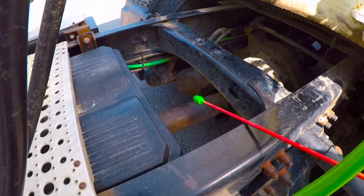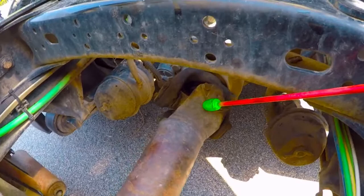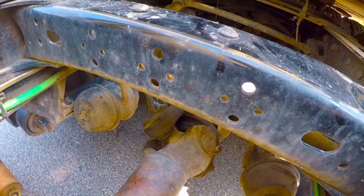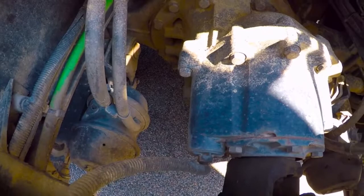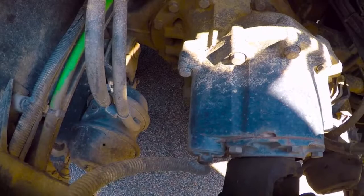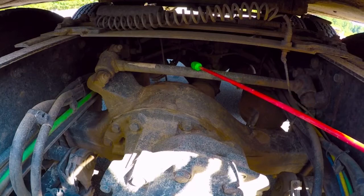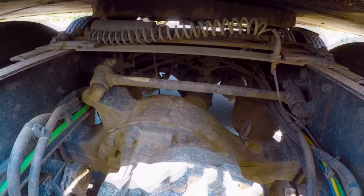I'm going to begin moving towards the drive axle. But before I do, I want to make sure my drive shaft is not damaged, not twisted, not bent or dented. Also my U-joint here does not have any excessive play — I go ahead and try to turn the drive shaft a little bit to make sure it's not loose, and it's not. My rear drive axle I'm checking to make sure it's not damaged, not cracked anywhere, and I don't see any leaking fluids. Looking back here, I can see this rod which is my torsion bar — I want to make sure it's in its proper position, not twisted, not broken, and all the bolts and hardware are there and in place.